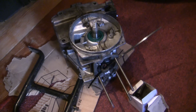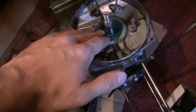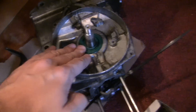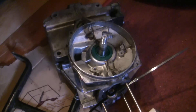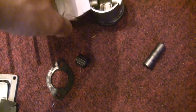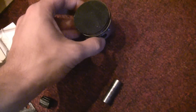We're gonna talk about some stuff that we broke, but it wasn't really roasted. The bottom end seal on our stator side — this is a double-lipped seal — started leaking on day one, so we had to swap out our motors on the very first day. A little disconcerting, but not a big deal. Something I'm pretty proud of is that while we never seized our nice Treats reed kit, we did swap the piston out in San Luis Obispo. The piston is in fine shape, considering we were not running a temp gauge — we ripped it off on the first day out of frustration, but you'll learn more about that in the main video.